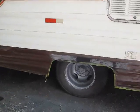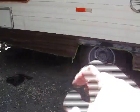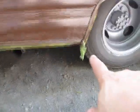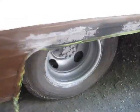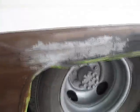Welcome back, another video. Doing some ship shape work here on the lower skirt, which, as you all know with the aluminum, eventually it bubbles up. You've got all these little funky bubbles and everything else that goes on here. So what we've tried to do is mitigate that a little bit by sanding them down, grinding them down, putting filler putty in. It's kind of a fiberglass base type. They call it steel putty. It's kind of like JB Weld. I wanted something a little stronger, a little more resistant to moisture. So that's what I did here.